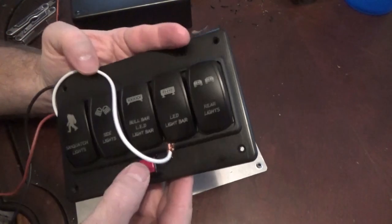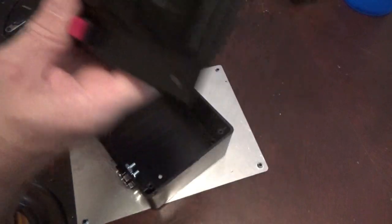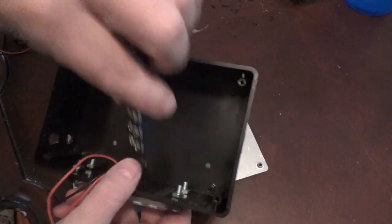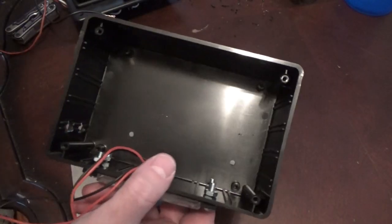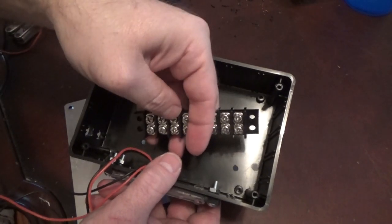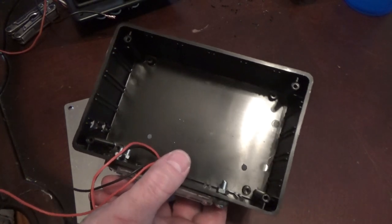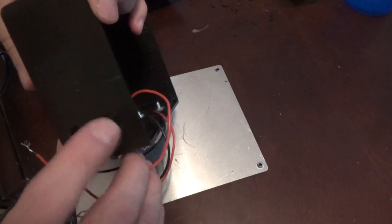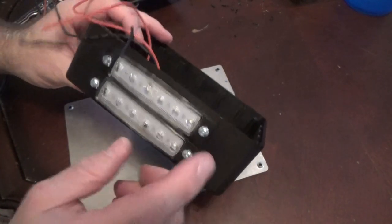So I drilled and installed a little switch right there. Put those in. So that's what we're going to be doing next. Oh, since we're talking about drilling, I went ahead and drilled two holes back here, on this little strip right here. What I plan on doing is making this section right here its own module. Then I'll tie my switches and stuff to this, as you'll see in a moment. Then coming out of the box will be the wires, going out to the relay box, which will be mounted under the hood for controlling all the lighting. So two holes right there: your power going in one side and your wire going to your relay packs coming out the other side. Of course, I drilled to mount those. So let's start doing a little bit more soldering now, and we'll start getting some lights hooked up.